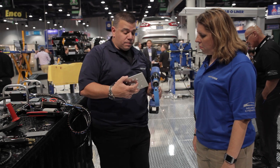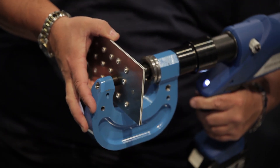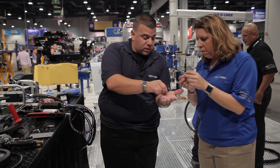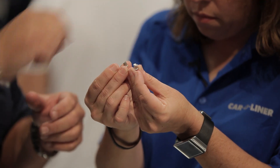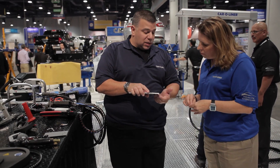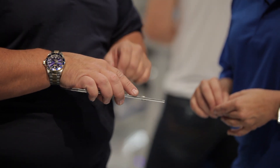The head rotates on this particular Henrob unit because the point is set up to take these rivets out. You get this lined up on one of these dimples, squeeze the gun, and once it reaches the point it backs away. So what you wind up with - the rivet presses outward. This is what the rivet looks like after removal compared to before you put it in. When compressed it gets forced outward, the metal gets forced inside the hole area and that's what makes it lock in. It goes through one piece and into the second one - not all the way through - creating a flange locked in area.